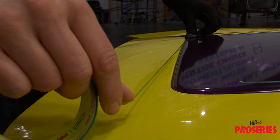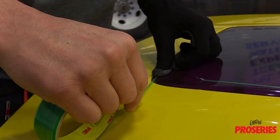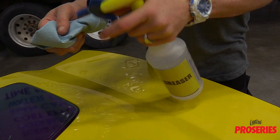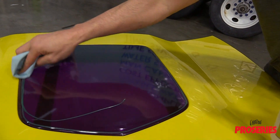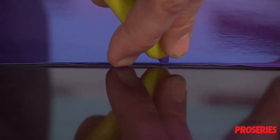When laying cutting tape, the Pro Glove glides easily on the top surface, which creates good workflow and ensures a straight line. If the Pro Glove is wet with a glide solution, it is very important to wipe down the cutting tape with a light solution of alcohol and water. This degreases the surface so when the wrap film is applied, there will be no contamination of the adhesive layer and ensures long term durability.